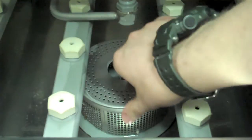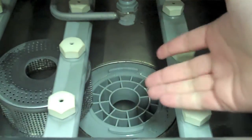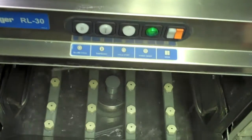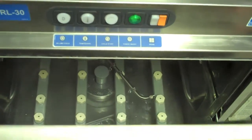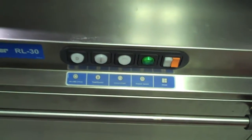When your machine is done draining, it'll probably look something like this. You may even notice some sediment around the scrap screen. Note, the machine will begin to automatically fill any time the power light is on and the door is closed. Do not open the front door as the machine is filling — this is extremely dangerous and could result in burns.